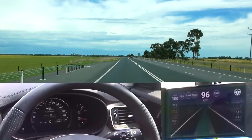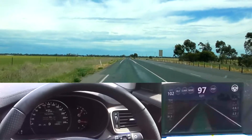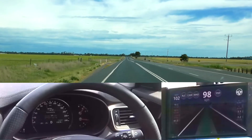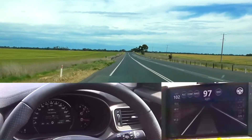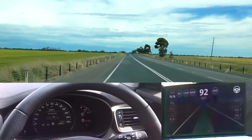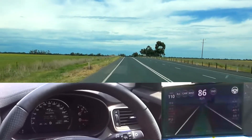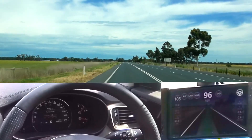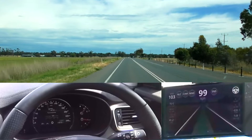While Mad is enabled and because I've got CAM enabled, I'm still going to get my lane departure warning. It doesn't kick in straight away - it kicks in after you first enable cruise control. So to enable it you enable it like you would normally enable OpenPilot, but in order to kill it you need to turn cruise off. Now you can see that OpenPilot's no longer steering. Turn cruise back on and we're in action again. You can't resume cruise because I turned it off - so yeah, it works on cruise being enabled or disabled rather than with a set speed.